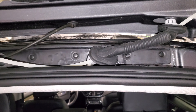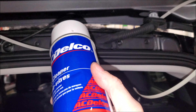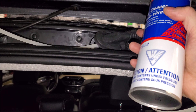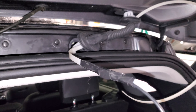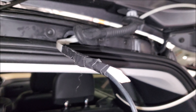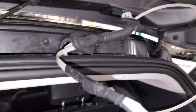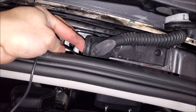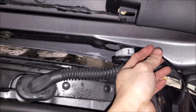Next you'll have to feed the wire through the boot for the rear camera. I find you can go to the local hardware store and get some giant zip straps, and I like to use glass cleaner as a lubricant to allow it to pass through easier. The reason I use glass cleaner over silicone lube is: one, some lubricants could be bad for the insulation and start to break apart the rubber on the boot; and two, silicone lube kind of just stays there, whereas glass cleaner will eventually evaporate and go away. Here I attach the cable with mid-grade 3M electrical tape — not super 33, which would be a waste, but it grabs well enough and it's tough enough. Now you can go ahead and pull it through.